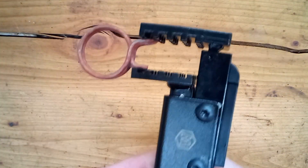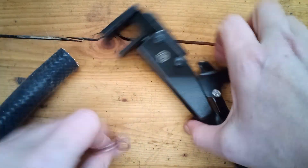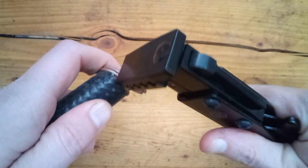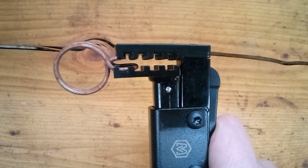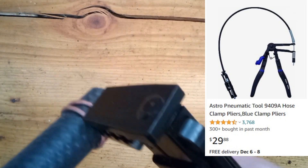You can see this a little bit better on the wire style clamp. The positioning of those wires is never going to line up perfectly with those waffle teeth, so I think it has to be able to twist a little bit. Next I tried using it to install a clamp onto a hose. I noticed you have to make sure that the loop part on the wire clamp is being grabbed by a tooth or it can slip off pretty easily. When you have it engaging on two teeth, it's rock solid. I can see this being an issue when you're working in a tight spot. I was hoping to use this on lower radiator hoses where you can't get a regular set of pliers, but you're also not going to be able to see what's going on down there, so it might be trial and error. Normally I use the cable operated style clamp on those, which is also a royal pain to get set up, so it's probably a wash as to which one is better.